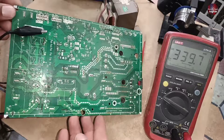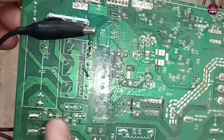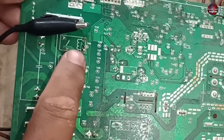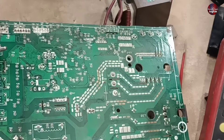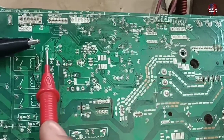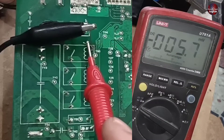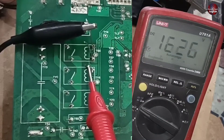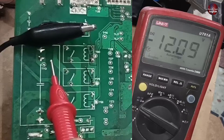Now I have made all the settings to check the voltages. I have installed the test pins and will check whether the microcontroller is passing electricity to these relays. After supplying electricity, the PCB started — the control board light is working. Checking one by one, we are getting 12 volts on this relay. This relay is connected with the black wire of the connector. It is clear then that this relay has gone faulty.